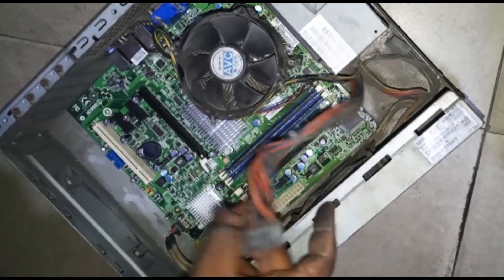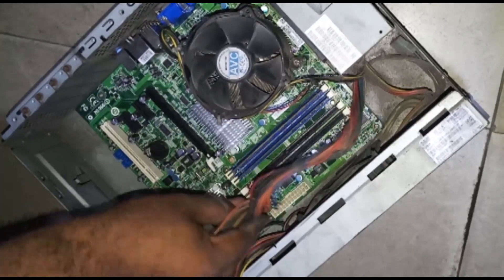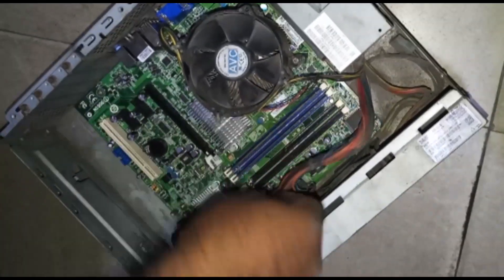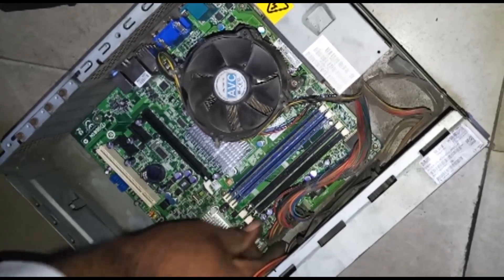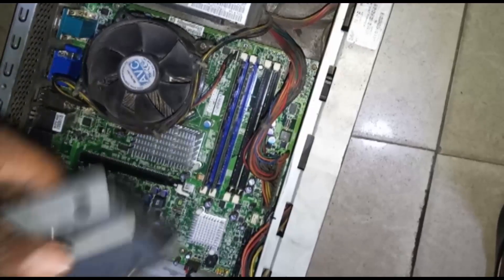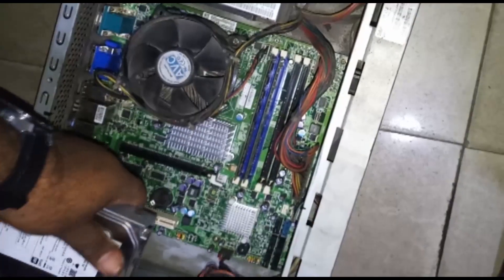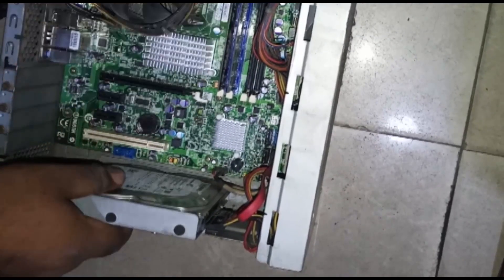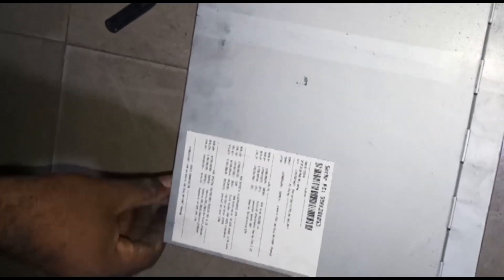This is the main cable I told you about - the one where you join the green and black wire together to find out if the board is the issue or the power supply. When your board is having an issue, it doesn't work at all, or it acts as if it's working but no light is showing. When you finish, connect your hard disk back properly. If there's a hard disk issue the machine will show different errors on boot. Once you couple your PC back and close it up, plug it back in and the machine will start working. That's it for this tutorial - thank you for watching.